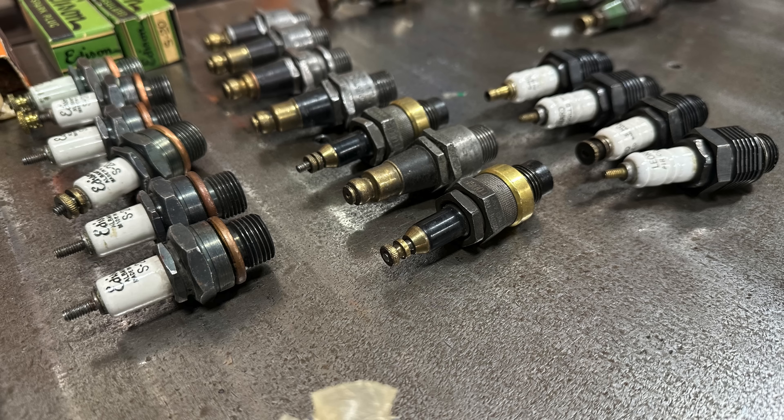There are a lot of museums that have cars that maybe haven't run in 50 years. But you drive your cars, and you need to understand what a fouled spark plug is because you've probably seen one recently. So if you're going to go on a 500-mile tour the old way, I would maybe spend $500 in today's money buying maybe 20 of the same kind of spark plug, replacing each one as it fouled. I'm a lot more conscious of that today — I know how to take a modern plug, machine it down, and make it work.